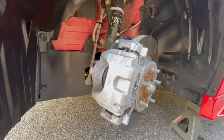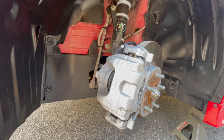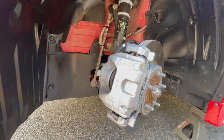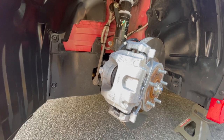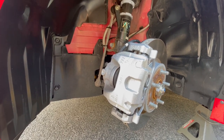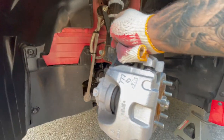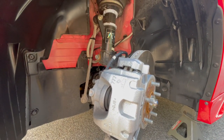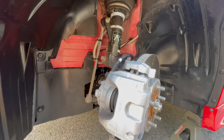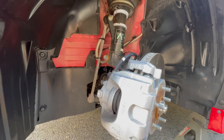For starters, you've got to jack up the car and take out your wheel. I have the car jacked up all around right now, because once I do the fronts I'm also going to bleed the back brakes just to be safe. I know I'm only changing the calipers in the front, but I suggest bleeding all four corners. We're opening the brake line and changing to the stainless steel one, so it's always better to do everything right for your own sake, especially if you're doing the big brake kit.